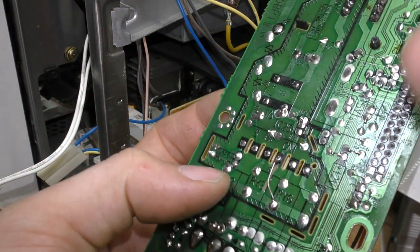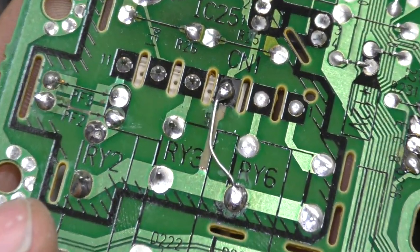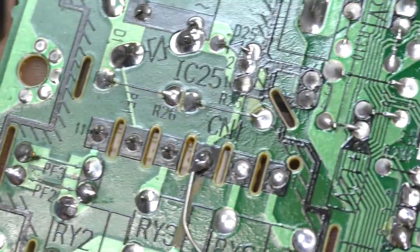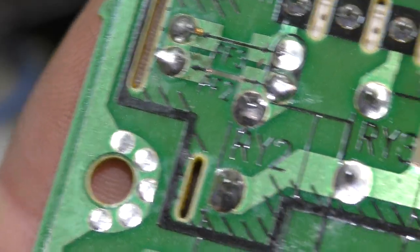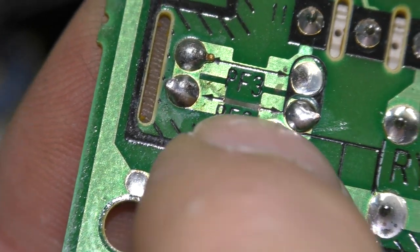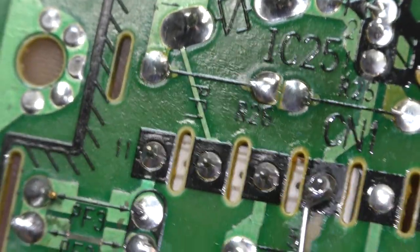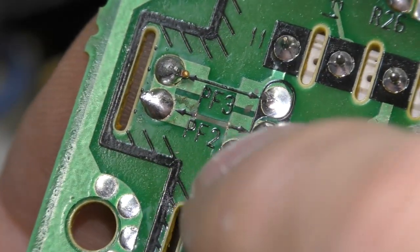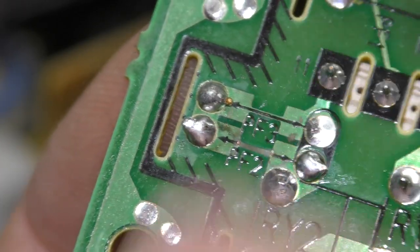In addition to the bulb blowing, the track to the relay that switches the bulb and the turntable motor are connected to the same circuit. What happened is here we have basically a PCB fuse — where it says PF2 — there's a PCB track that has just disappeared. It's just vaporized when that bulb went. There's also another track that blew off the PCB as well.